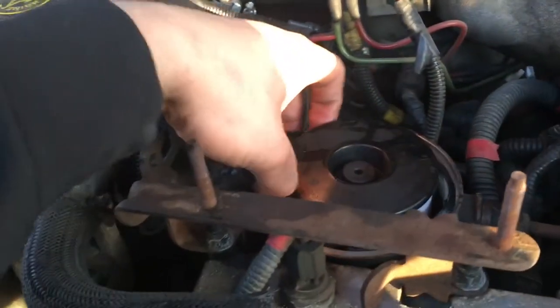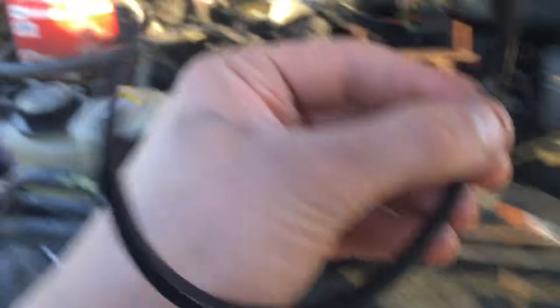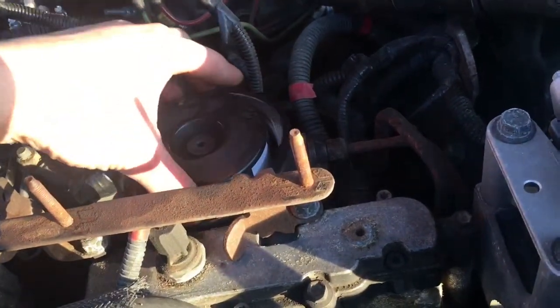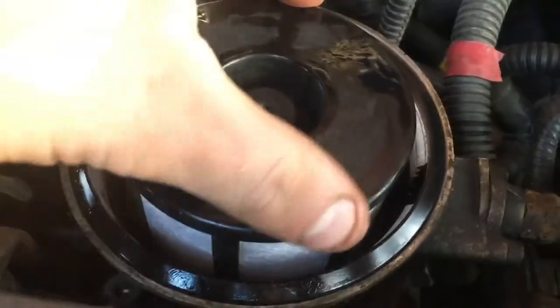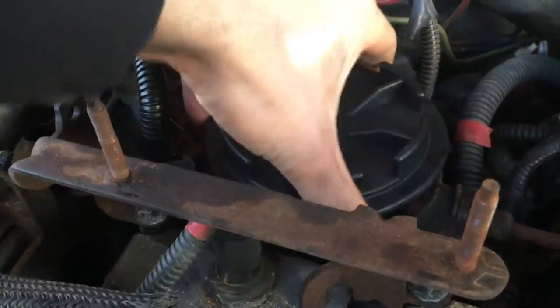I don't like this o-ring — it's all bent up and not seating right, and the old one doesn't look bad, so I'm just gonna reuse it. I rub some diesel on the o-rings so they've got some lube, and then the cap goes on. Slowly tighten that down.